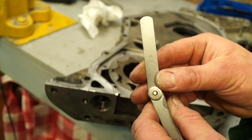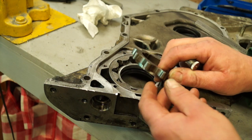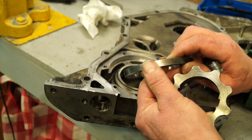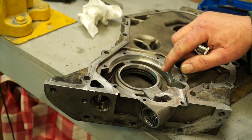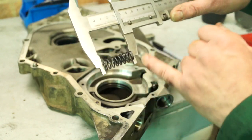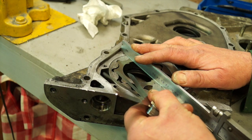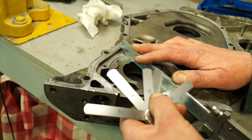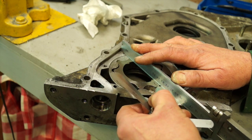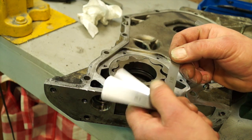The oil pump is no good for putting back into service — those rotors are well out of tolerance. The housing may also be worn, but we need to check that with another set of rotors. In summary, we have a pressure relief spring that's too short and rotors that are out of tolerance. This is a very important measurement because the oil pump is the heart of the engine — a bad oil pump will quickly result in a very worn engine. The motto when doing an engine overhaul is: expect the worst, and anything you find that's good is a bonus.